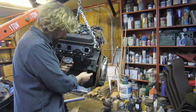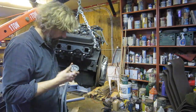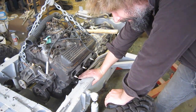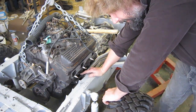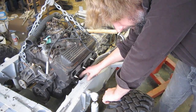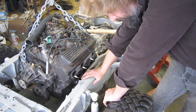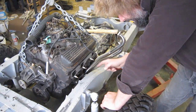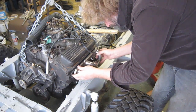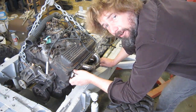What I'm going to arrange is some kind of 90-degree fitting — come out here, up on an angle, and then 90 degrees back in. Even in brass there will still be pipe fittings since this is a half-inch pipe fitting, but it should work. The motor's back in. It's really tight in here. To keep the motor in the standard Land Rover position, hard over to the driver's side, I had to get quite tight with the motor mount. You can't remove the headers with the engine in place, but you can roll them out of the way to get at the motor mount. It's these tight block-hugging headers that make this swap possible.